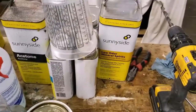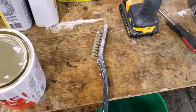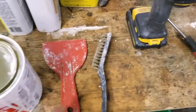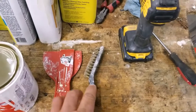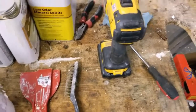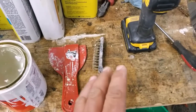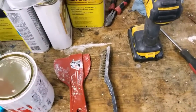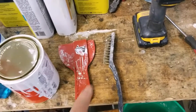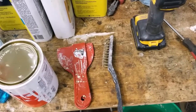I finish it up around the rivets when I'm done scraping. I'm using various sized scrapers — like a three-inch all the way down to an inch and a half. Once I'm done around the rivets, I use a brass wire brush — not a steel wire brush. The brass is softer than the aluminum, so I don't want to gouge it up. I'll go around the pop rivets in the side of the boat with that — works really well.